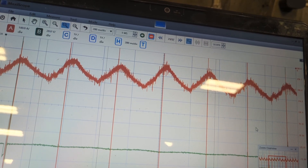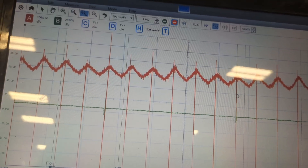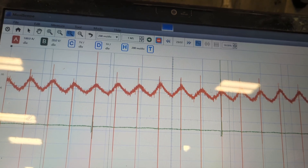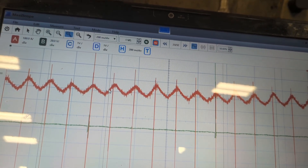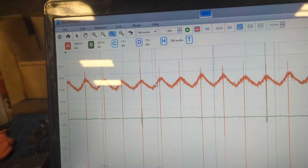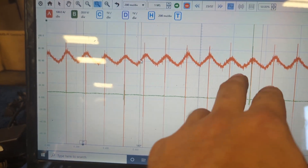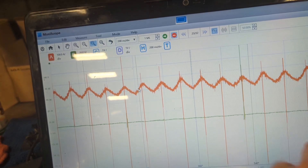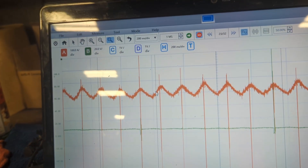These two seem pretty low compared to the rest. If I zoom out a little bit — here's my ignition sync: high, higher, higher, low, low. Number two is actually pretty low, so I think we're gonna have an issue on cylinder number two. Firing order on these is pretty easy — it is 1, 2, 3, 4, 5, 6. So we have 2, 3, 4, 5, 6, then 1, then 2. Cylinders one and two seem to be the lowest out of them all. This is only relative, guys, so it's just comparing them to one another, but yes — one and two are pretty low.